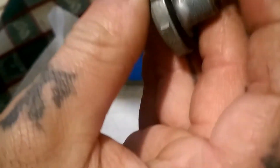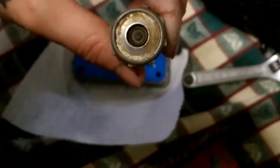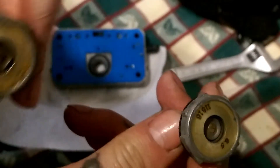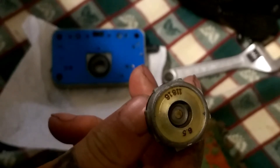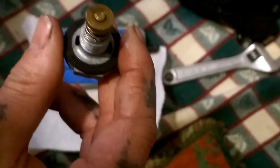This is basically the same exact power valve — I don't think this one has a number on it anymore. But this power valve — it'd help if I hold it in the light — this power valve is working pretty good, seems right. But what's happening is my vacuum isn't right and it's making the power valve act all crazy. So let's go ahead and install the new one.